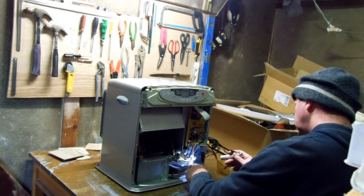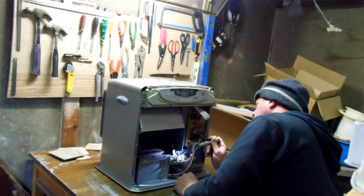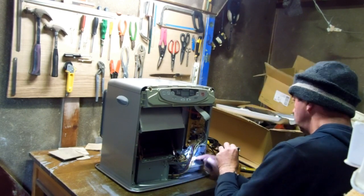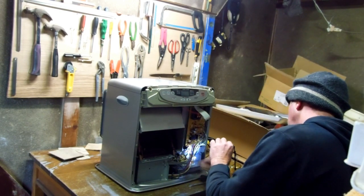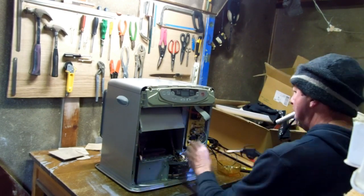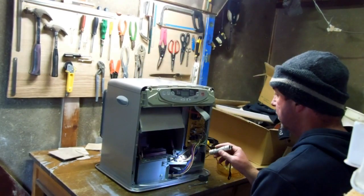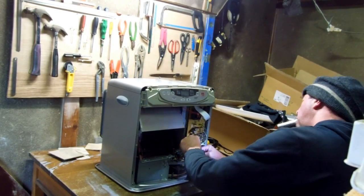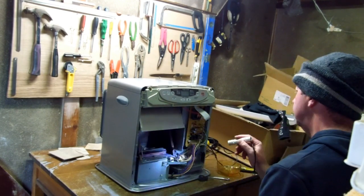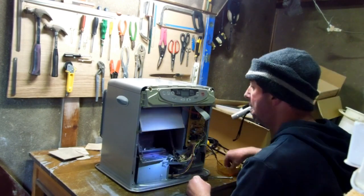They've got lots of sensors in there. If the air in the room hasn't got enough oxygen in it, or if the area inside the heater is too hot, all sorts of things will shut it down. It's got all these safety features, so it's obviously one of those safety features that's shutting it down. If you bump it, it'll shut down, in case of earthquake. But this one little metal pipe that feeds the kerosene into the burner was really, really hot. And it was sort of like the final straw.